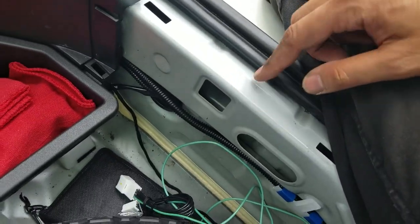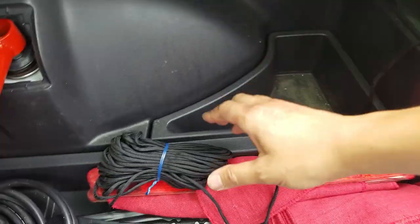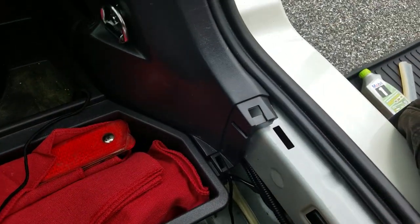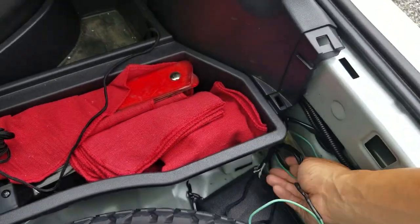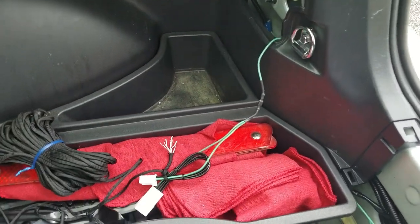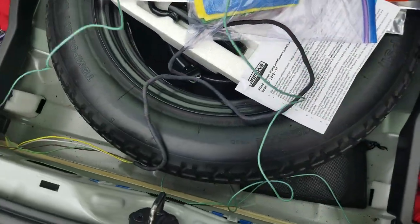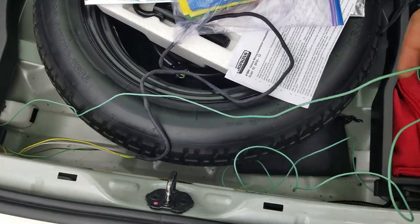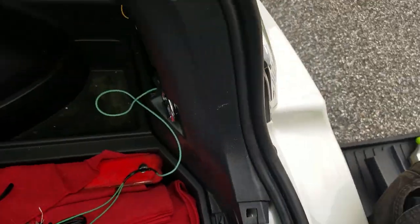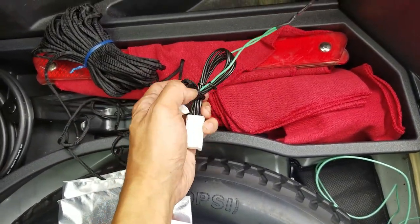Getting the green wire up and out of here is going to be a lot harder than simply dropping the wire down. What I've actually done is used some paracord I keep in the car — I just dropped the paracord down here and tied off the end of the wire, so now I'm just going to stick the wire down here and pull it out. That's the easiest way to run the wire through. There's plenty of extra green wire that comes with it, so once I get everything plugged in and zip tied I'm just going to roll up the rest of the wire and zip tie it out of the way.